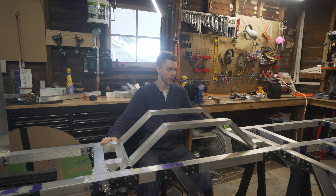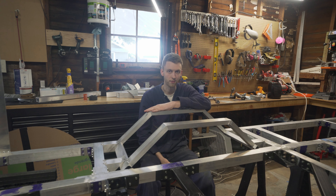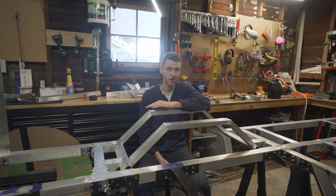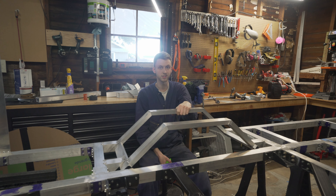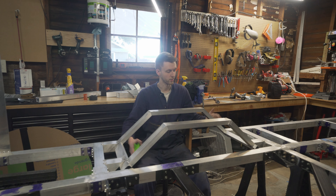It's not until recently I figured out that I can make the wheel wells way smaller, which is great from an interior space perspective. It turns out on a factory van the wheel wells are only about 10 inches high off the vehicle frame. I was talking to Justin from one of the 4x4 van groups and he put his van up on a forklift and fully flexed it out — with his van completely flexed he still had six inches of clearance between the top of the 10 inch wheel well and his 37 inch tire. Mine would essentially be the same configuration, so I get to make the wheel well way smaller in height and width.